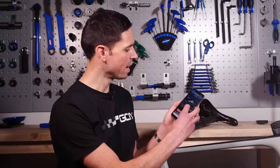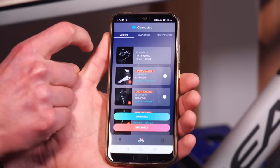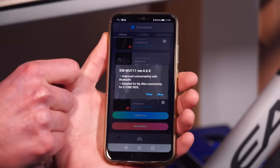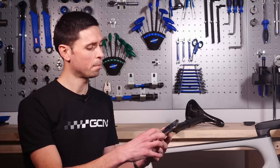Having connected to the module, your phone will display all the different components of your bike that you now have access to. Before changing the host of different features, it's important to go to the update section and scroll down — you can see there are quite a few components that need updating. The first important one to update is the Bluetooth module itself; that'll ensure a reliable connection and avoid problems down the line. When updating the module or any component, it is super crucial to let it complete the process fully and not disconnect the app or phone from any components — otherwise you could find your gears aren't working and it's a trip down to the bike shop, and nobody wants that.